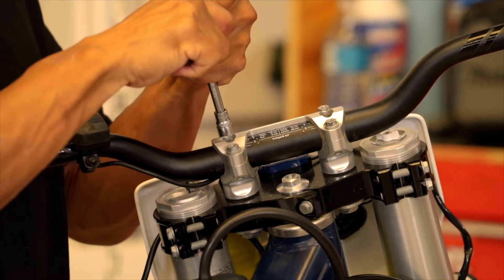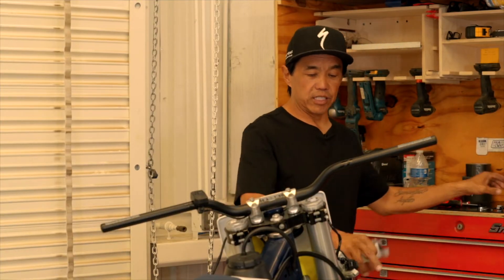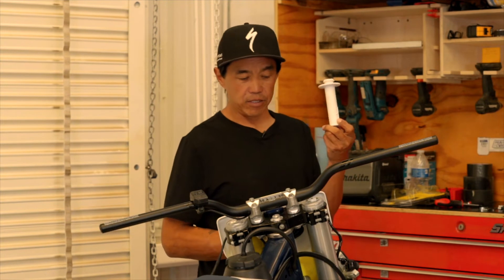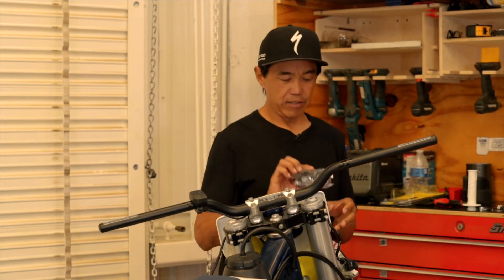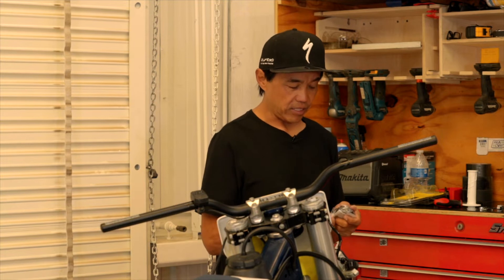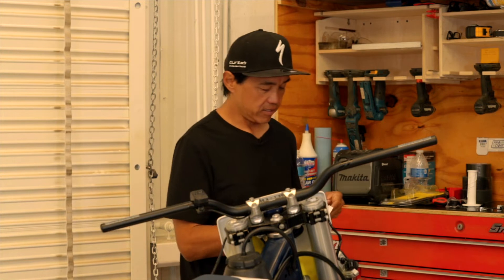As my dad said, this is my torque wrench. You may have noticed I didn't slide the throttle onto the handlebar before installing it — that's because we're changing the grips. ProTaper supplies a left side grip and a right side throttle tube, which comes with about eight or nine different throttle cams designed to fit every single bike. There's an application chart inside. I believe the Husqvarna is cam A — let's double check.